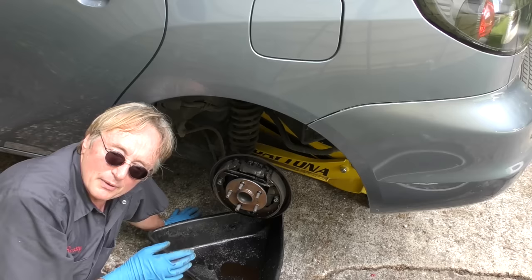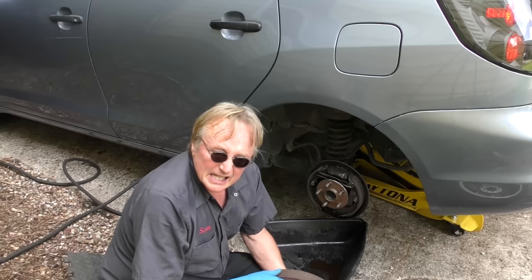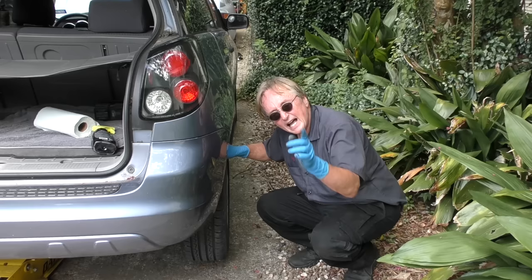This stuff does stink, so use a big fan. On the inside there are three little pieces that rub against the drum. If you're doing an actual brake job when you take the drum brakes off, get a little brake grease and put a small amount on each of the contact points so they don't squeak. We didn't take it apart, so the grease I applied when I did the brake job a few years ago is still in there — they don't make any noise. That's pretty much it for drum brake maintenance. They adjust themselves with an automatic adjuster, and we sprayed that clean. Every time you back up and slam on the brakes, they tighten themselves.